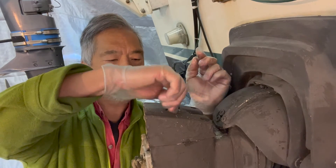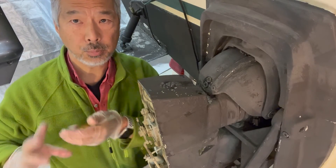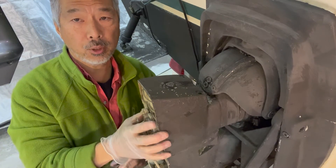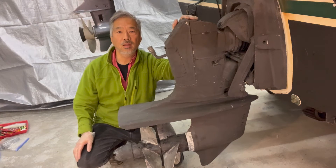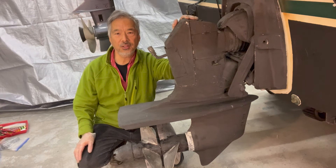Making sure that o-ring is there, we'll tighten the dipstick up — just snug with the screwdriver. Don't want it too tight because there's a gasket under it. Then we'll replace the transmission cover and we'll be all done. That's all there is to changing the oil on the lower unit of one of these Volvo Penta Dual Prop Out Drives.